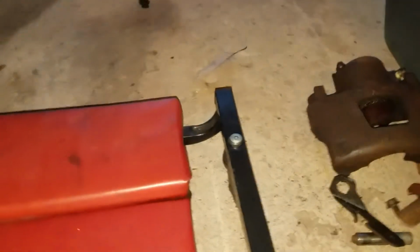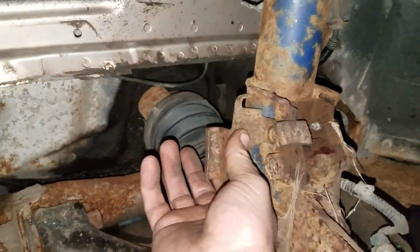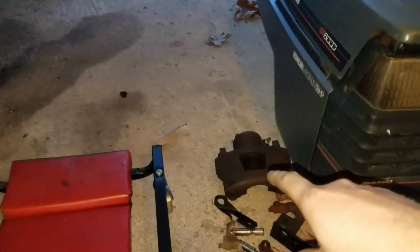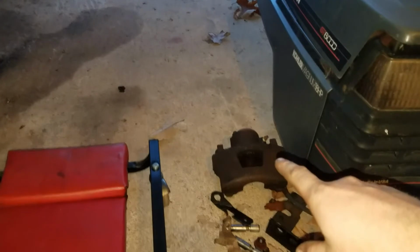Another thing I've been doing is I took a wedge and opened up this bracket to get the old line out so I can salvage the original bracket here that holds the brake line for both sides. The calipers I wanted to check to make sure they were moving properly, in which case the pins and the rubber bushings were a little stiff.